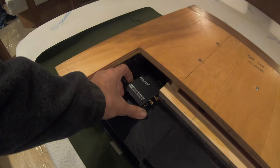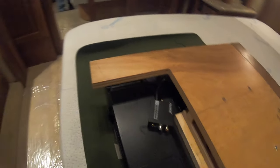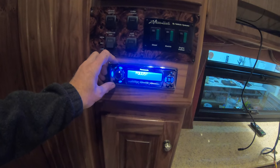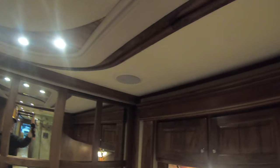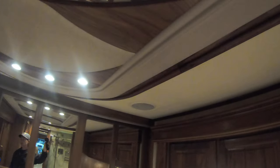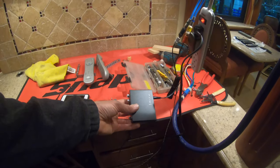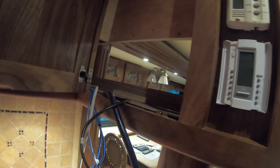In the back I'm going with a digital-to-analog converter so that I can get the bedroom Panasonic to be able to pass the audio out of the TV, which gives you a good rich sound out of the two six-and-a-half inch speakers in the ceiling. And I'll end up having to do an HDMI-to-component converter on this TV so that I can get the HDMI image on the other side over to this television without running a new cable, because the existing cable is component video.